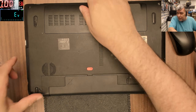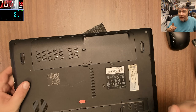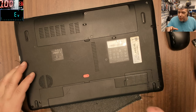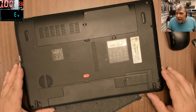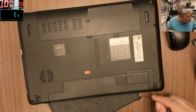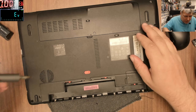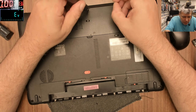Okay, this is a good laptop. Remember when I told you about the hinge - the hinge has no problem right now, but most likely when you open this laptop the hinge will get broken, because it's quite an old laptop and the plastic is very fragile. It will break when you open it, so keep that in mind when you make up the price for this job.